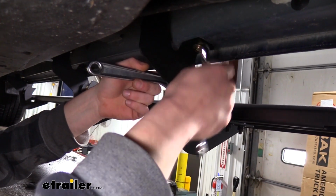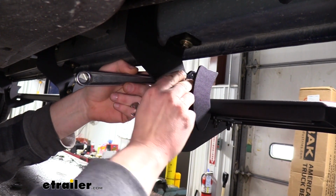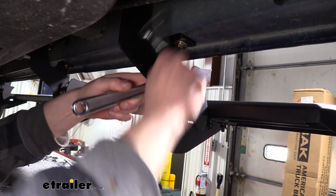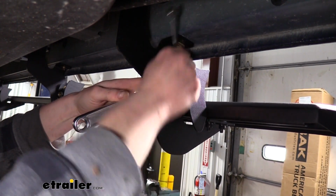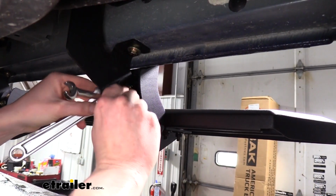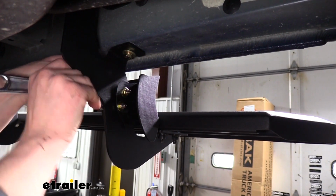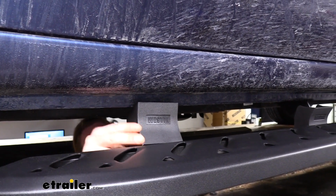And then we can go back and tighten up our covers for our mounting brackets. And again, these are also adjustable. Since these use lock nuts, it does take a minute to run them down. And you are going to have to probably use a couple of wrenches, maybe a small socket to get in there due to the way the covers wrap around the hardware. So that way it is making contact with both the vehicle and the running board. That way it'll just take up any gap and hide our bracket as best as possible. We'll then repeat that for the 2 remaining covers.